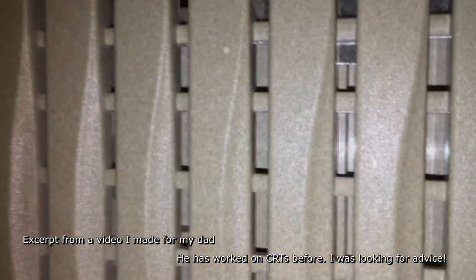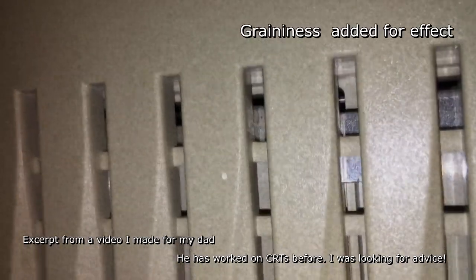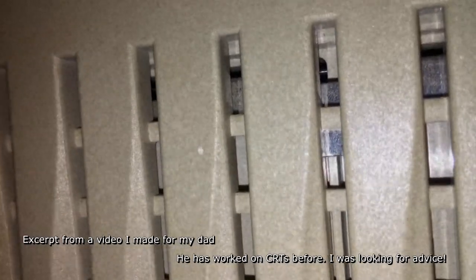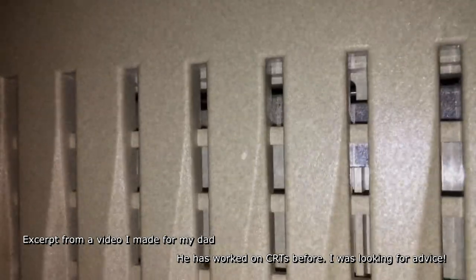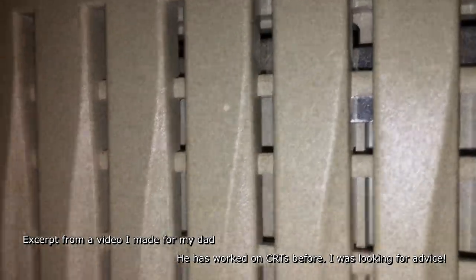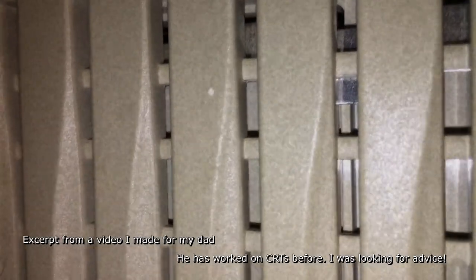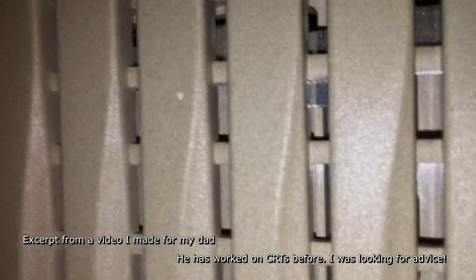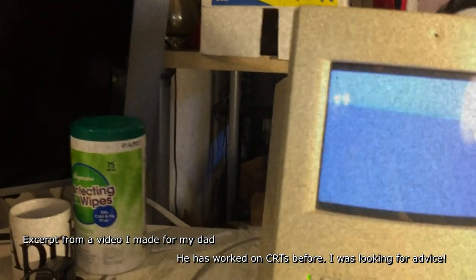The hard drive, which is on this side, should be making clicking sounds — that would be the sound of the read head on the hard disk moving around. But listen to what you hear instead: it spins up and then winds back down. I believe that's a sign that that hard disk just had it.